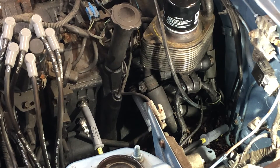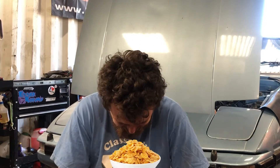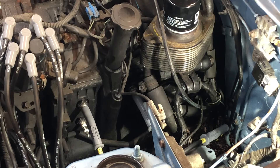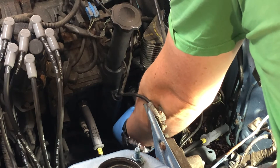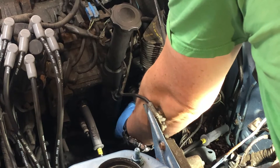That would be an engine with a face down, if the numbers are bad and it's not making the right noises. Or you'd have no noise come from half of the rotor if you had a rotor down, or no noise from all of the engine if you had a complete engine down. Essentially, that's what we'd normally refer to as a poor man's compression test — it's not going to give you any numbers, but it's going to tell you whether your engine's actually still producing compression or not.